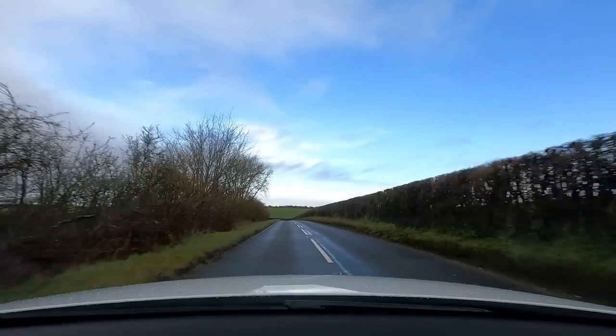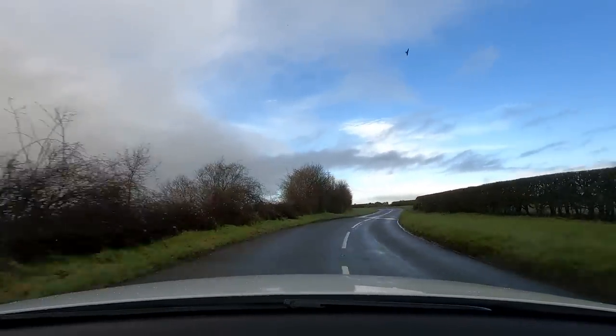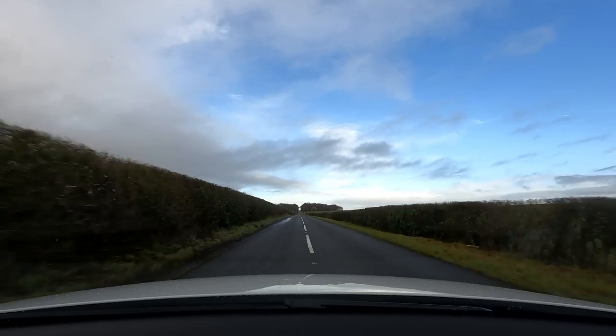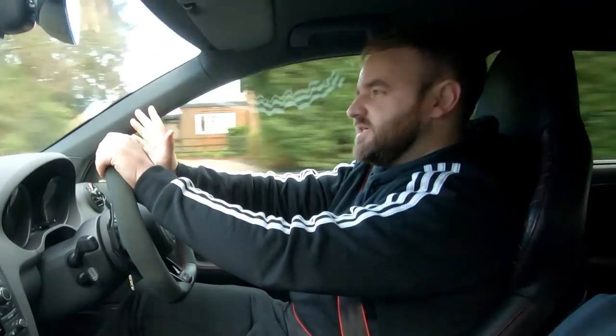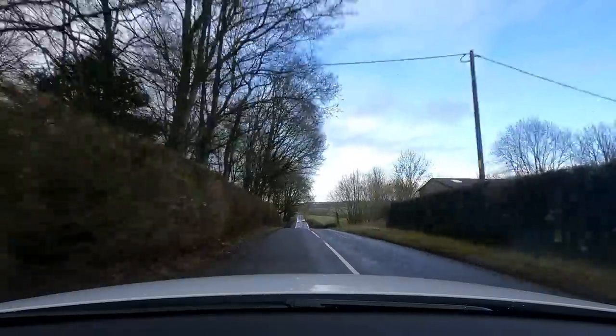Good in the corners — it's proper point-and-shoot, isn't it? The suspension makes it feel like a go-kart. It's got a 0.34 manual ARB in the rear, which sorts the handling out as well, and obviously the coilovers. It handles really well in the corners. Any other bits underneath? It's got all Powerflex bushes on it, an anti-lift kit, and the subframe has got a Deadset kit on it — because these are quite prone to the subframe moving, so that just aligns everything up, stiffens it up. It's also got a dog bone mount on it.